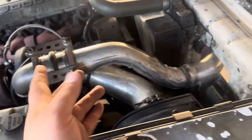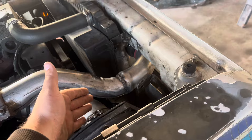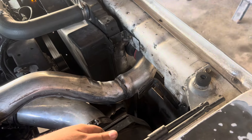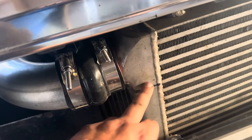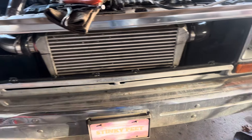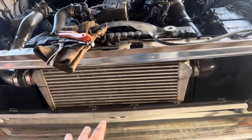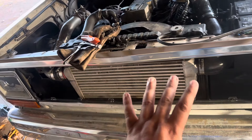What I'm doing with this bracket is nothing hard — just welding it on and bolting it in. I might have to make a new boost tube anyway because I'm going to a bigger turbo, bumping up to a four-inch exhaust and bigger intercooler, so that's why I'm not going above and beyond to make it look perfect. This definitely gets hot — even right here at the intercooler my plastic grill was melting from contact, like around 600 degrees. One improvement I plan on the intercooler is hooking up a windshield washer bottle to spray cold water on it with a switch.